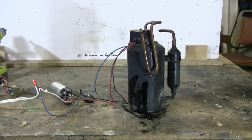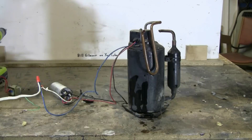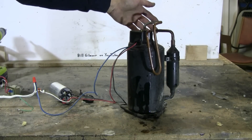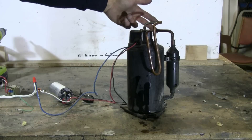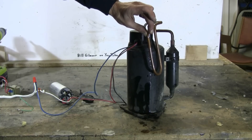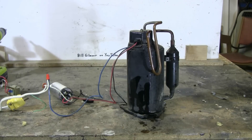The unit is now ready to plug in and test. Let's see if we've recovered a live working compressor or a dead failure. Plugging in now. I hear activity. I have good suction holding my finger against the suction side. There is air blowing out, and it can build up pressure. This is a working little air conditioner compressor, now properly wired and functioning. According to a sticker found inside the body of the air conditioner, the high-side pressure on this one was 400 PSI, so this compressor should be capable of some nice high-pressure air work.